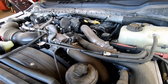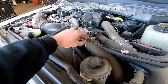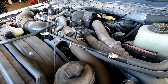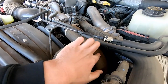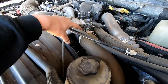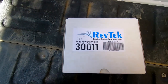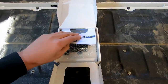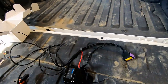The neat thing about new diesel trucks is they already have a valve built in right here. This is a 6.7 Powerstroke and there's a valve already in the air system — kind of like a throttle valve. This kit is actually just going to piggyback into this, so you don't have to install a big new positive air shutoff valve like on some of the old ones. This is the RevTech 311 part number, listed as 2011 to 2017 Powerstroke, but it works on pretty much all 6.7 Powerstrokes — I just installed one on a 2019 the other day and it worked.